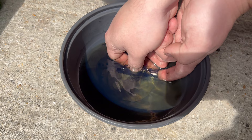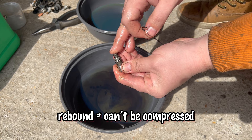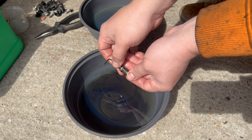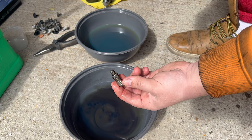Now it is clean from inside. The Mazda workshop manual says you shouldn't have any rebound in it — if you press it, it shouldn't spring back down. Now I'm going to remove the diesel from it, and since it is empty from inside I'm going to fill it with engine oil, as the Mazda workshop manual requires.